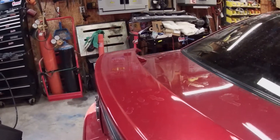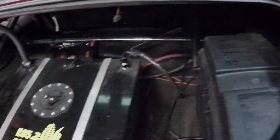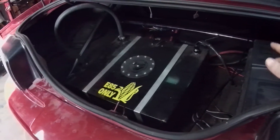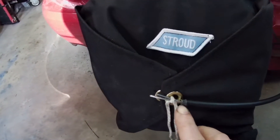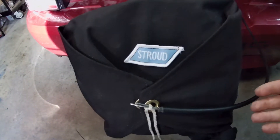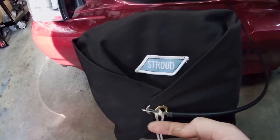In the trunk it comes with quite a bit of cable to work with. I've got it looped up for now since I may need to move it inside to the shifter area. Once you figure out where you want it, you can trim the cables shorter - release the handle like you're pulling a chute, the cable sucks back into the sheath, you measure what length you want, cut it with bolt cutters, snip it off, close the handle, and the cable comes back out and you're good.